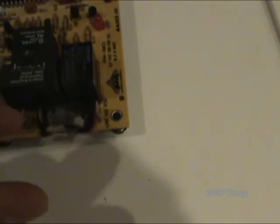Now this is actually the installer's fault it seems. I don't know how it lasted this long, but they didn't protect the wires that they connected here, and when the AC wires got too close together it arced and burnt this board away here. So you can see the PCB material is actually burnt right out.